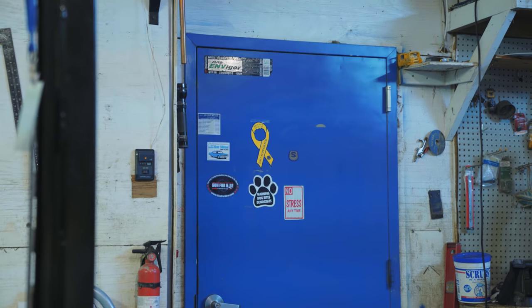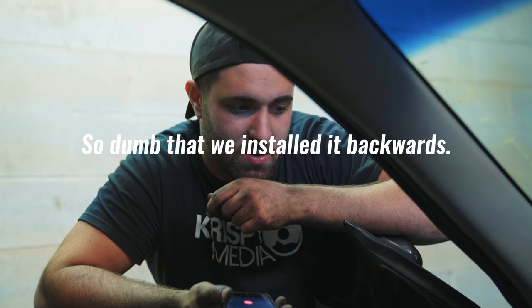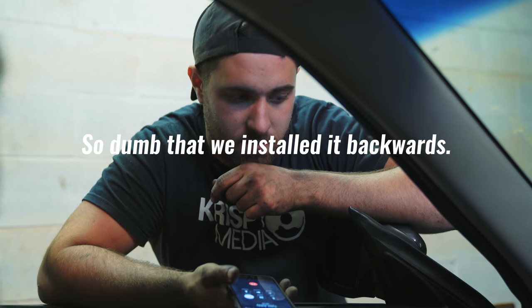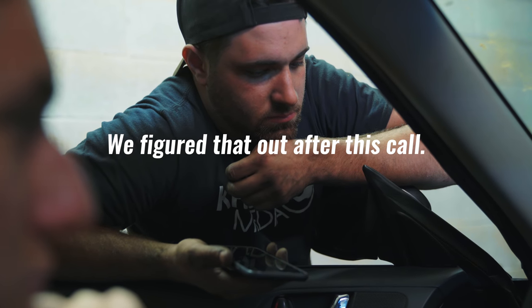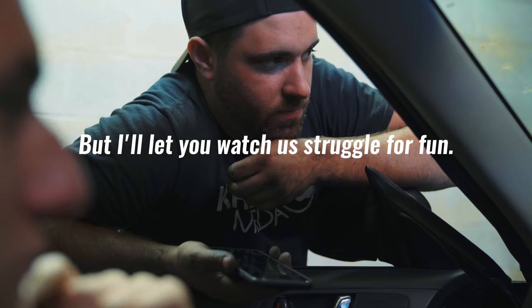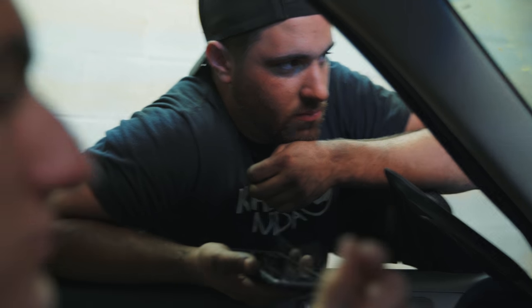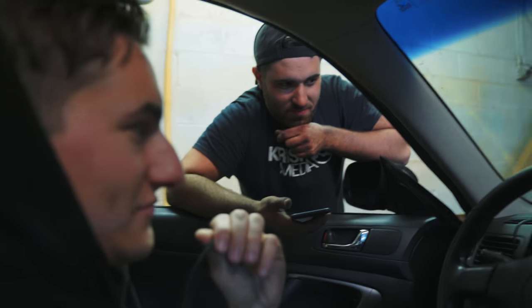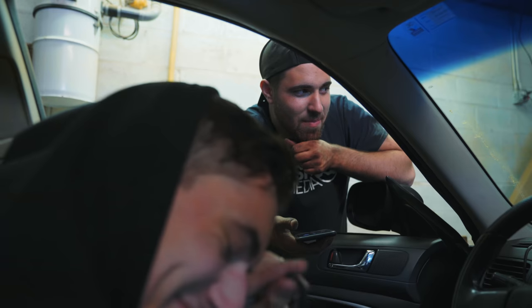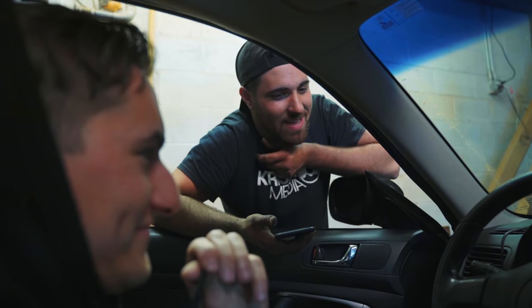Yo, remember when we were doing your Cobb and stuff like that, and we kept having the issue with the mass airflow sensor? Like it wouldn't start? With it unplugged, it's got a leak. It's got a boost leak. It's got a wicked big boost leak. It's got to be big. That's just like what my issue was. Didn't you go to school for automotive? Yeah, I did. And my best friend who had a WRX kept popping Y-pipes, I knew he had the same issue, so that's why I called you.